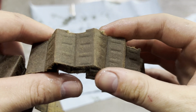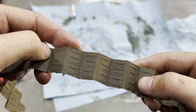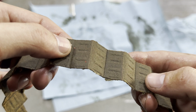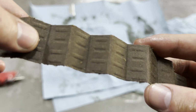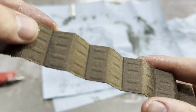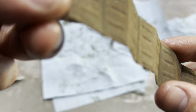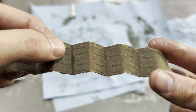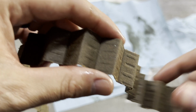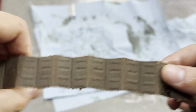This is our filter material scraped clean of oil, and you can see there's a little bit of sparkle on there. Again, that's just some paint pen or something from assembly, but this is the side that the unfiltered stuff is coming in from. You can see a tiny sparkle every now and again, and that's probably nothing to be seriously concerned about. Those are just tiny pieces of aluminum coming off of transmission pieces. I guess bearings are going to be steel, but there's a lot happening inside this engine, and it's spinning at a pile of RPM, so this is absolutely nothing to be concerned of.